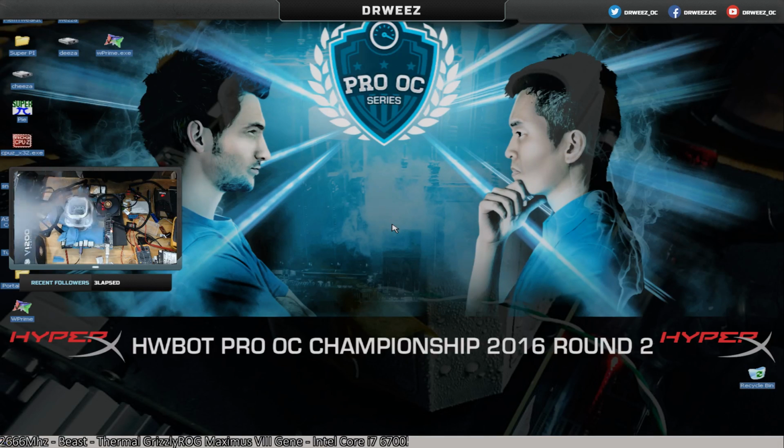I was looking at tuning the memory a little bit, but I have got some interesting condensation issues going on, where the cold, due to the current climate in South Africa, is a little bit different than I expected, and coming through the memory DIMMs up to the third DIMM, which I haven't insulated. I've got a little bit of frost build up there. Not great. So I have reached what I thought I would be able to do with the CPU, and I'm going to give it one more try.